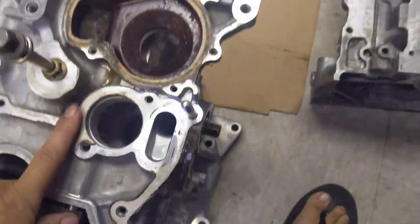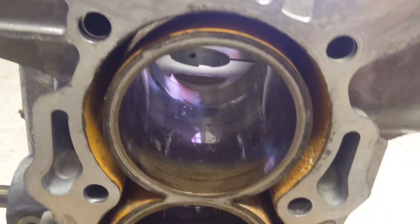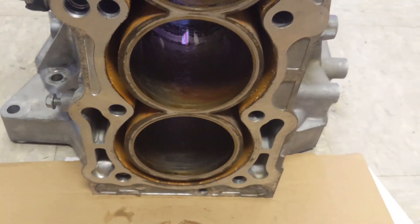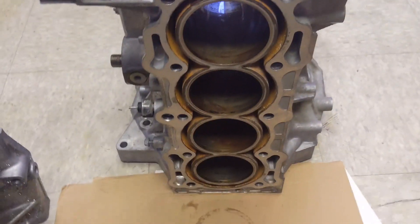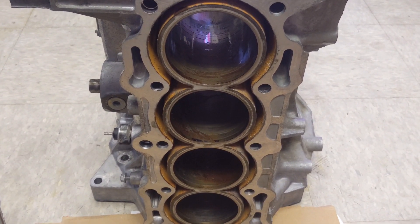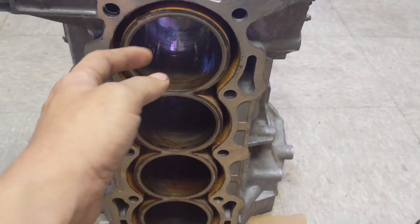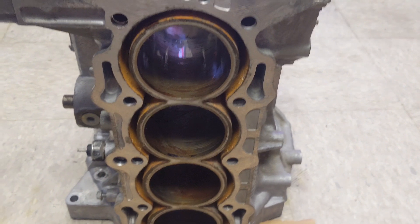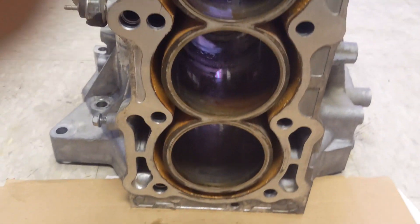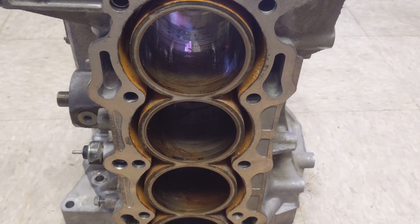This one's fresh out of the hot tank, so they actually have a conventional steel liner. What's really popular is guys run a K piston for an all-motor build, but what we're going to do is a deck insert — like we've done the Godzilla deck for the B's and K motors and D series — we're going to do one for the F23A next. With that conventional steel liner, we're hoping this will be good.